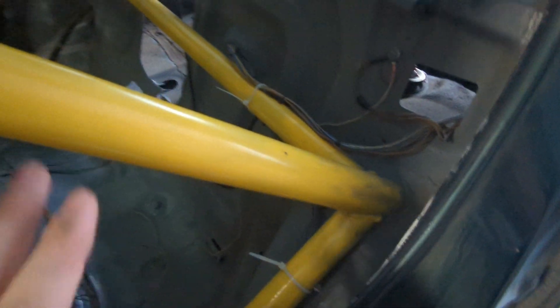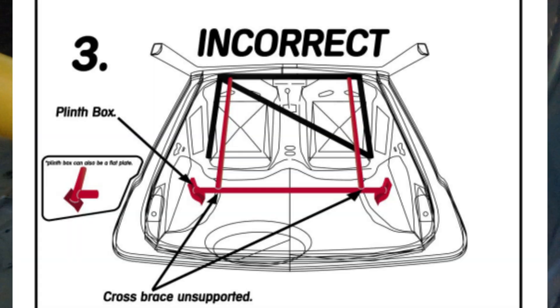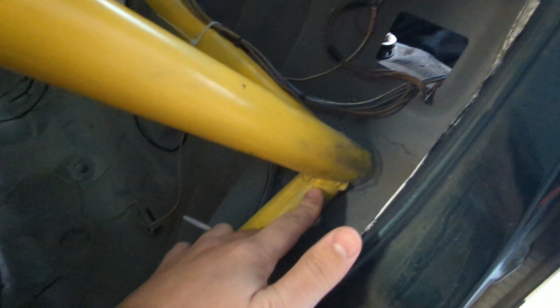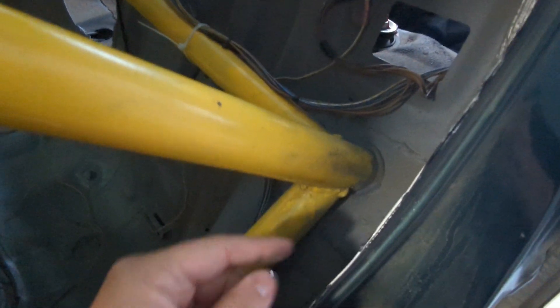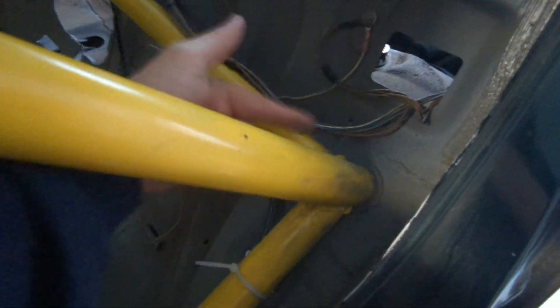A common failure point at tech inspection is when the down tubes land on the horizontal bar rather than going to the floor — this is more common in coupes. Shown here is an example of what not to do: the down tube landing on a horizontal bar. The correct approach has it landing on the plate with all other tubes connecting into it. All welds on any tubing have to be 360 degrees, so plan your triangulation carefully to ensure the first weld doesn't block access for the second.